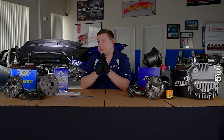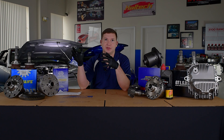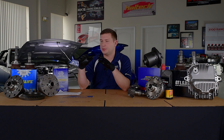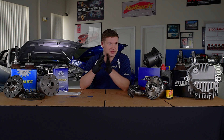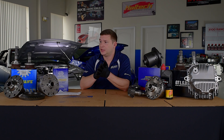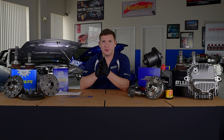We are going to follow up and expand in depth on the characteristics and traits of each diff — what diffs are suited for what usage. Whether you need a full race-type clutch-type diff or something like a Helical from Cusco or Wavetrac may be a better option. OS Giken, Tomei, Kaaz, Cusco, Nismo GT Pro — those are a few we'll cover. So whether it's for getting groceries and taking your girl out or full-on racing, we'll cover the super awesome traits and even some negative traits in certain scenarios.